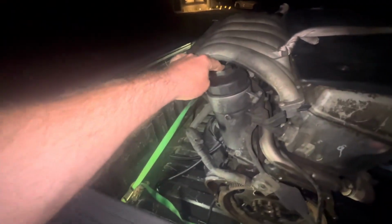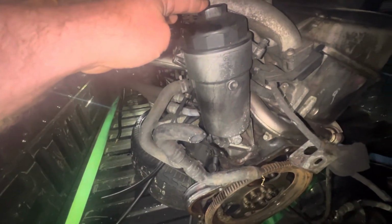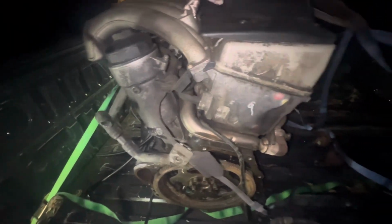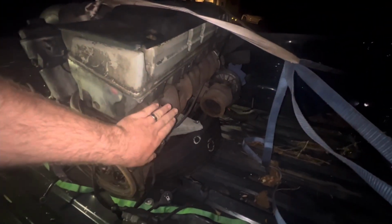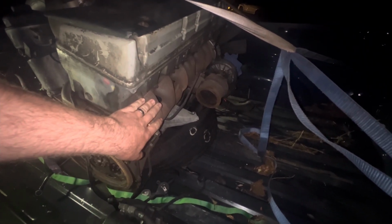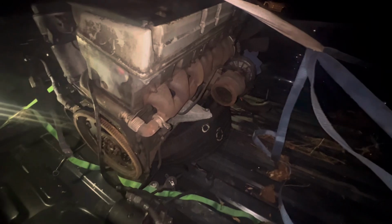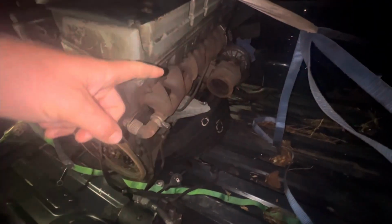Potentially gonna look into this, seeing if we can do something different, if this is close to the brake booster and all that, because there is another option that has recently been discovered by a good buddy of ours. More than likely going to be getting a new manifold from Benz Force as well. They offer an extremely nice one that gets rid of this triangle for the turbo mount and is a T3 mount, much nicer than this OG manifold. Definitely going to get a better turbo.